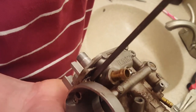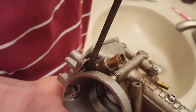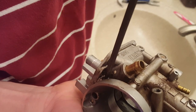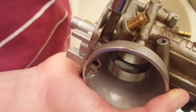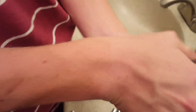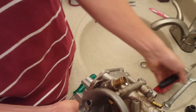Now you want to unscrew the air-fuel screw, but first check what it's originally at. Right now we're at zero, then half, one, one and a half — and that's where it should be. He just unscrewed it just a little bit, so now just back it out fully. Then grab that spring in there — it's kind of hard to grab but just get that spring.